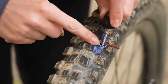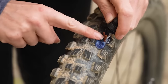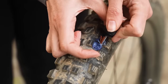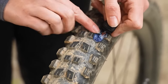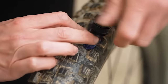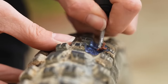Once you've found the hole, push the plug in gently so there are two halves either side — it'll fold in place and give you double the amount of plug in that hole. Push it in gently enough that the end is just poking out enough so it doesn't go into your tire, but not too much sticking out or the trail might rip it out.